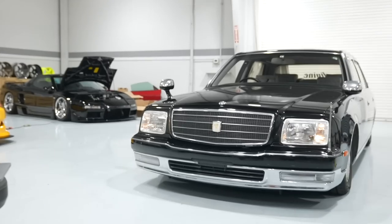Obviously you can see the change of shirt — we went and got dinner and came back because we were going to try and take the car to dinner and ran into a small issue. My fault, absolutely my fault: when we first installed the airlines and ran them inside the car, when we put all the shielding back on I didn't make sure that any of the hardware was out of the way of the line. One of the nuts was slightly putting pressure on one of the lines and it was causing it to air up weird. We diagnosed it — thankfully the line is okay, not a big deal — and we were able to fix it and get this thing actually calibrated.